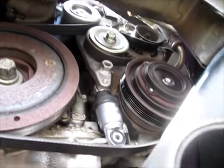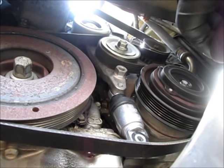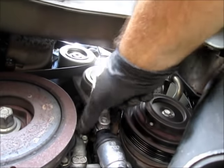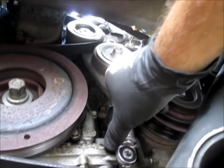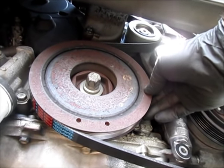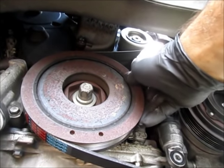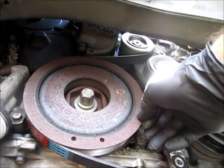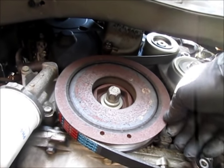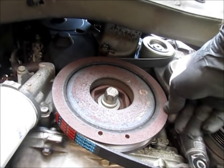Well, I've got the belt up in place following the pattern — you know how serpentine belts go all over the place. Things just got a little more interesting. I was working on moving this around to try to get the shock tensioner thing in place, and you're not going to believe this — look at this. That may have been what my real squeak was. I've never seen that before. So yeah, that escalated quickly. I'm not going to worry so much about the tensioner right at this moment — I'm gonna have to go find a balancer. Apparently.